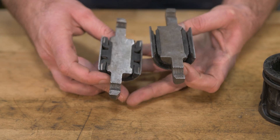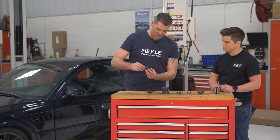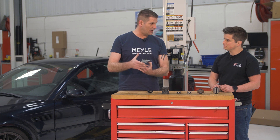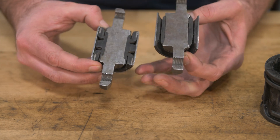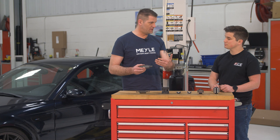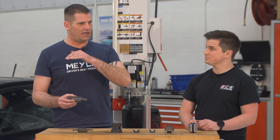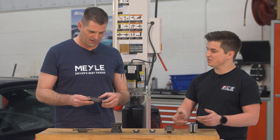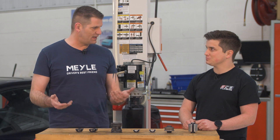So we have the hydro bushing where the oil and hydraulic fluid would be inside with fluid channels, and you can see this area is occupied by the fluid so we cannot use it for the connection of the outer housing and rubber — that's the major problem. We have designed a full rubber-metal part without any hydro fluid, which gives us the possibility to extend the lifetime and durability of these parts. That doesn't mean we don't have hydraulic bushings — we do, but only in those cases where we see they are longer-lasting. If they don't perform, we replace them with a special design rubber-metal part, and people are happier with the quality since they don't have to replace them every 20,000 or 30,000 miles.